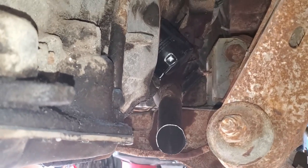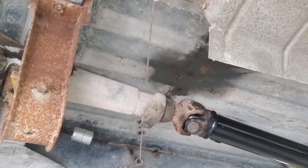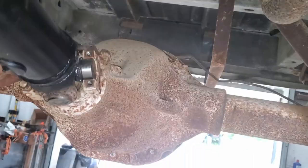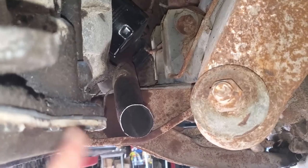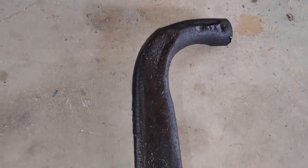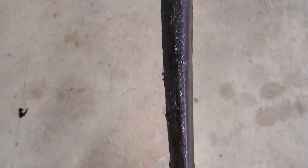Got that exhaust scooted over a little bit, finished up that transmission pan, and the Dodge Whisperer is working on installing the driveshaft. Fresh new parts on clapped out parts. Maybe now with this exhaust moved over, making this a straight pipe right through here - a lot better than the crushed pipe that was underneath the transmission. This is the pipe that was under the transmission - as you can tell, it got real skinny, real fast. I'm going to guess this thing had a hard time breathing.